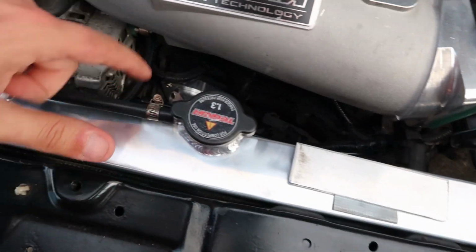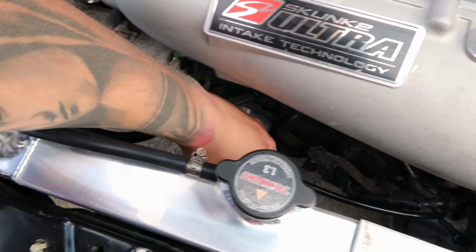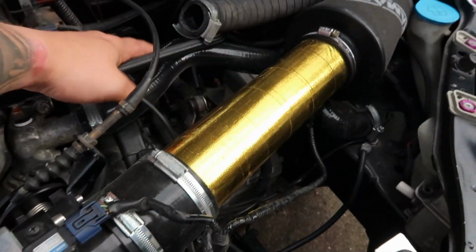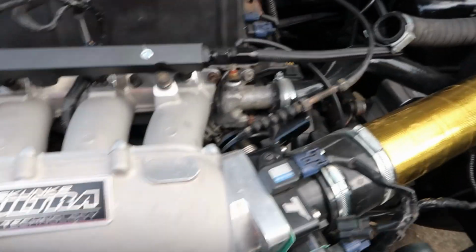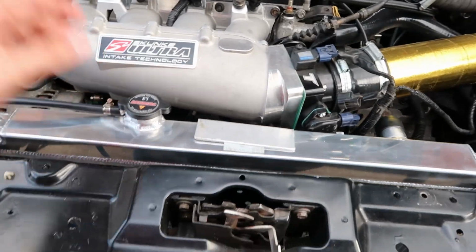Yeah, so once the radiator is out again for the 100th time, just tighten up this thermostat housing, and that's pretty much it, because I know that this top pipe clears a lot better than it used to. That one there will be all right. I'm going to run the fan switch and temp sensors where they were. I'm not going to put them onto the rad for now, so I'll just tighten all these little bits down, and then once we've got the two hoses on, it should be all right to fill her up.